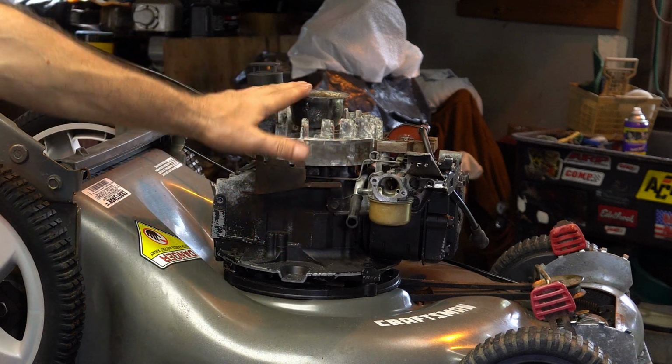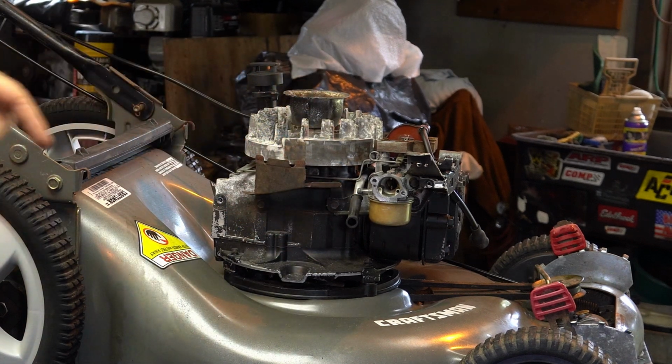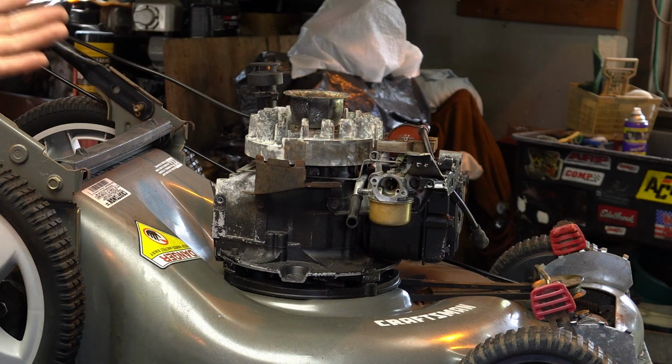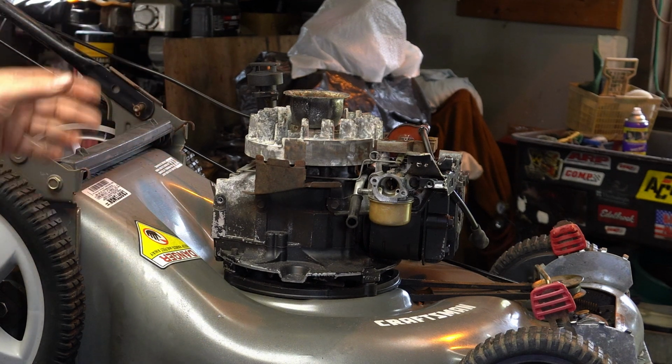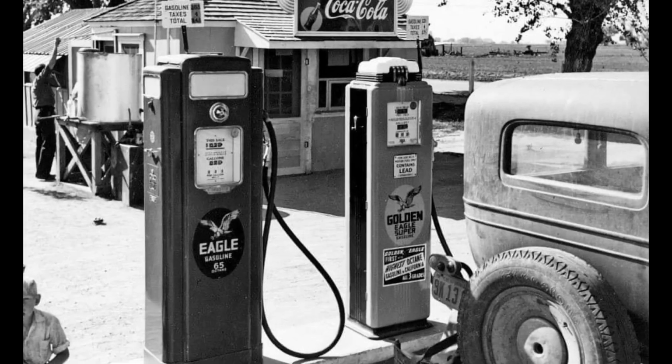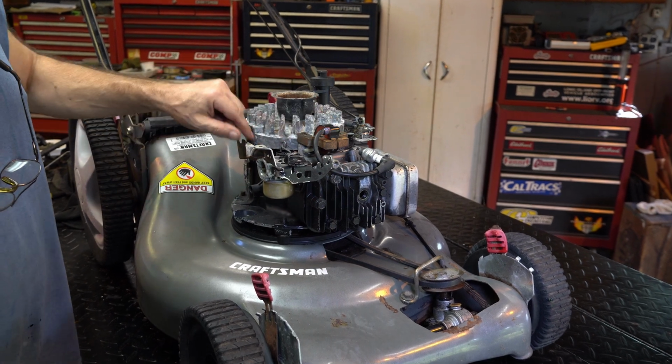The carburetor's on. I got a good magneto on there. I just want to check for spark real quick to make sure that that coil I just put on is working. It should be. Usually I check them before I take them off, but just to make sure before I put the hat on. All right, fellas, we got a spark. So I cleaned the magnets.